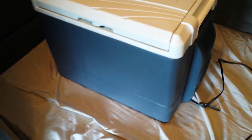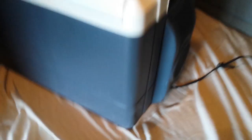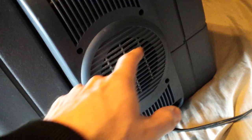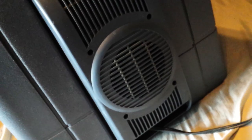Let's take a look at why I think some people have issues with this cooler. A lot of people say the thing burns up in a couple of months. One reason is I see a lot of guys block the back — you need air across those fins at all times. If you don't let airflow come across those fins, you're gonna burn it out. Another thing is keeping this vent clean. You can see all the dirt and funk in this vent — you want to keep it clear because this cooler works off of ambient temperature. You can pop this cover off, take the screws out, clean it, make sure it's clear, and stick it back on.